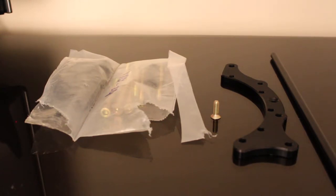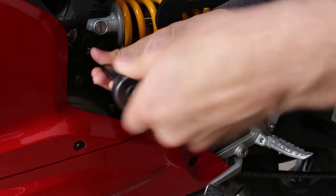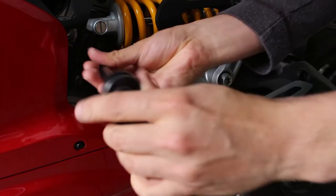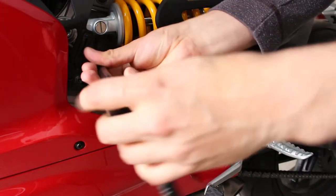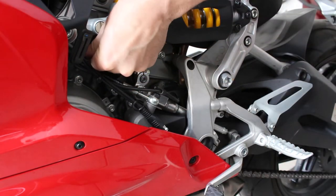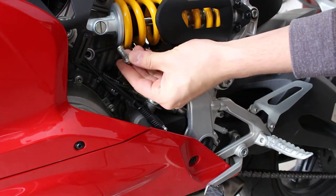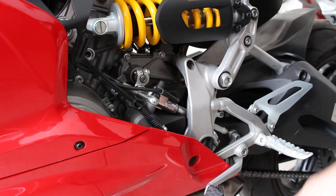The brackets for this are really good — they're made of aluminum T6, anodized in black, so you have that strength with the aluminum brackets, but you have the softness you need in the frame slider when it's coming into contact with the pavement. The great thing about the impact surface material is that once it grinds down — say you get in a low side — you can just replace the puck. You won't have to replace the entire kit; your mounting brackets will still all be there and the worn piece can be replaced.